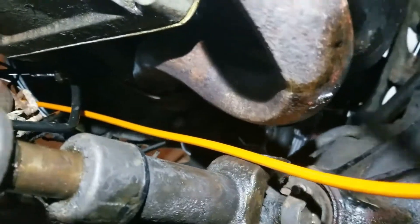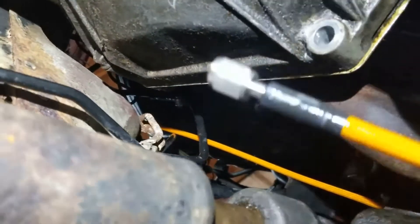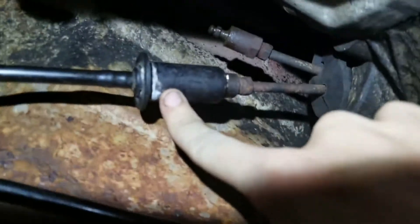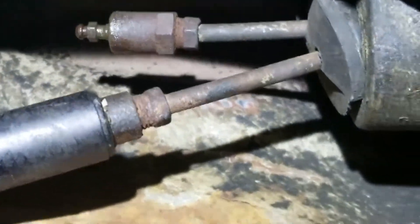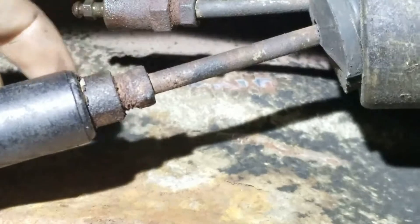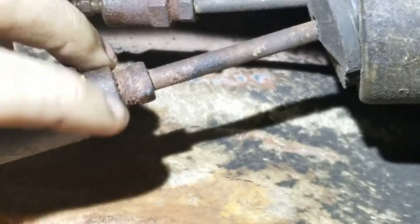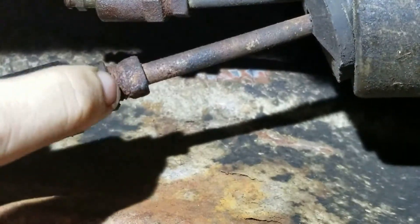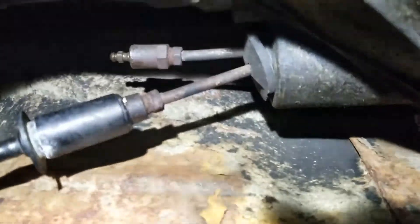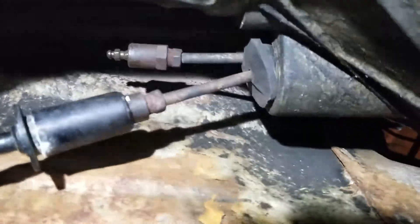Up under the truck, I've got the line running down here. You can see it's got that AN3 fitting on it. On the slave cylinder down here, what we're going to do is remove this whole quick disconnect. To do that, we're going to unthread these two pieces here. This one looks pretty crusty but hopefully it'll still come off. I think this is supposed to be hexagonal. We'll try to twist this off so we can use it for the new adapter fitting. Once we get that fitting on, I'll come back and show you the final few steps.